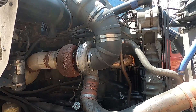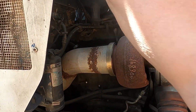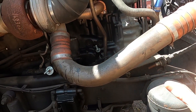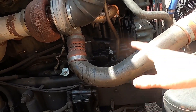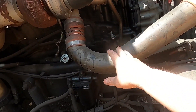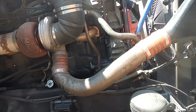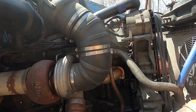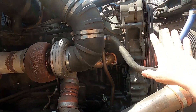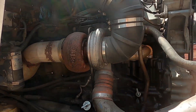I've got to take this entire air cleaner system off because it can't be there to get to the valve cover. So I've got to take the air cleaner housing off, take this off, take this off. I'm going to go ahead and take this air charge cooler line off only to make it easier on myself — it's not in the way of getting the valve cover off, but it'll make it easier for me to stand on the frame and get up in there. I should not need to mess with the radiator, top hose, top line, alternator, or any wiring.